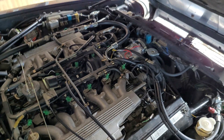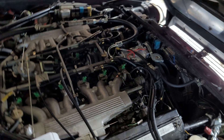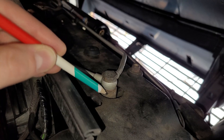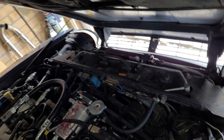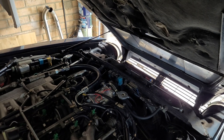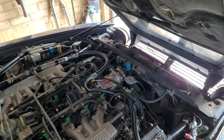That concludes all the additional bits. The most important item of everything covered is the banjo fitting — making sure the cross-hole is open and aligned to the radiator. If it isn't, none of the air bleed system will function, the radiator could accumulate air at the top without you knowing, and that could cause serious issues. That's the main thing I'd look at.